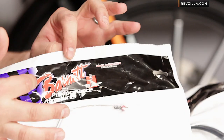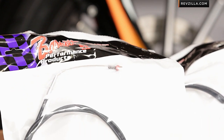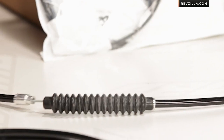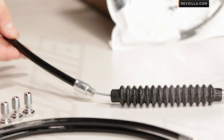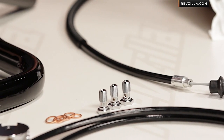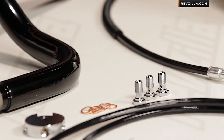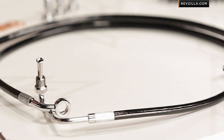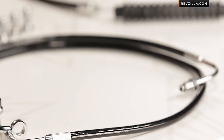When we opened up the box, they use some big name manufacturers to produce some of their cables. They're available in a couple of finishes: black and clear vinyl so you can see the stainless beneath. That vinyl coating is super nice — cheaper cables aren't vinyl coated, and what can happen is the stainless braid can act as an abrasive member on your paint and your frame and tear stuff up, so this vinyl coating protects those items. It's kind of an important step, especially if you spent big money on your paint.